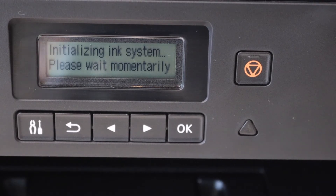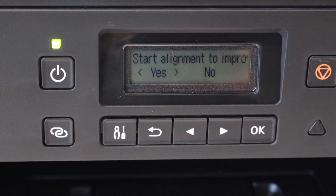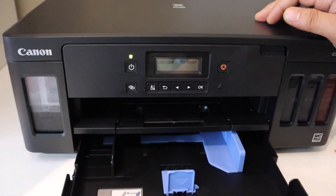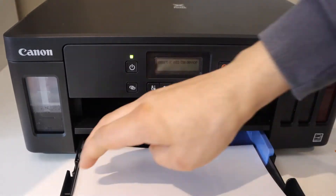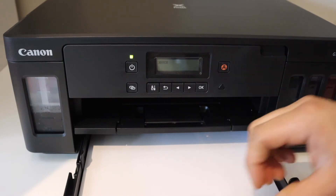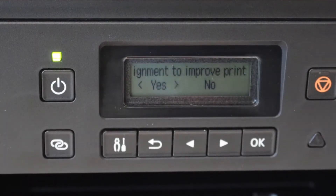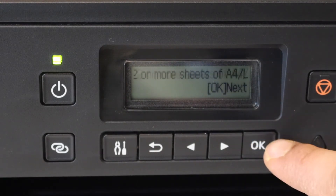Close the lid, close the door, and go to the main screen. Wait for the ink system to initialize. It's now asking to improve the print quality, so first we will load the pages. There are two paper trays — one at the bottom and one at the rear. Install the paper, close it, and click Yes for alignment. We've already loaded the paper so click OK.